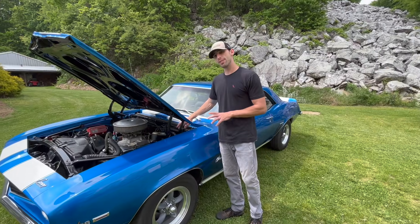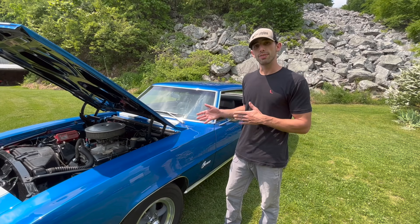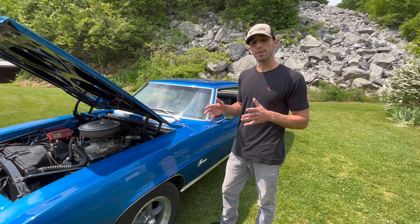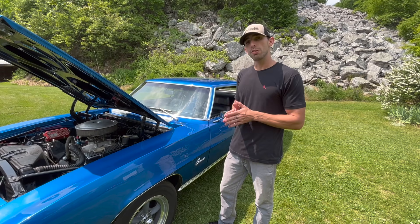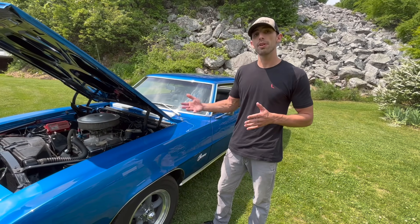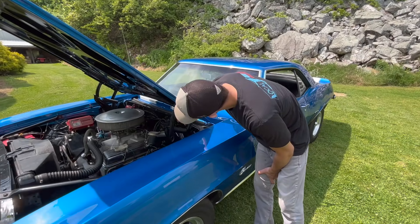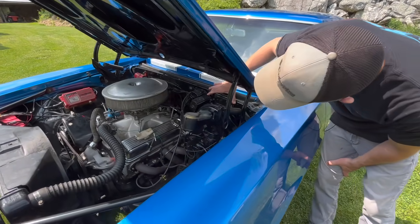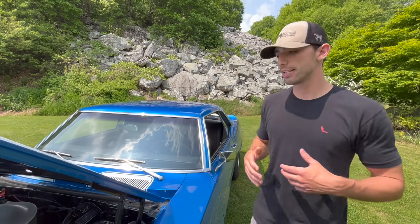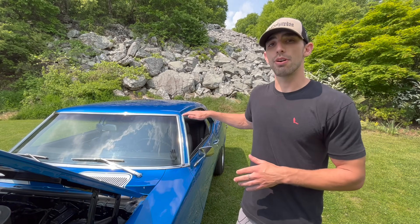There are no X codes on 1969 Camaro Z28s until about mid-December 1968. If your car was built after that time, you definitely have an X code. If it was built before then, it was either built in Los Angeles, where the tags look different — they're a lot longer and never had an X code — making those cars very difficult to verify as real Z28s. Los Angeles cars did come with broadcast sheets or build sheets on the actual gas tank, but usually those are all corroded away.